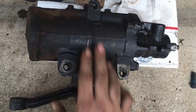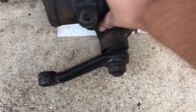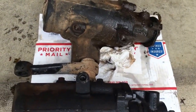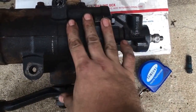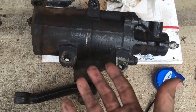Judging by that, I think this came off of a 4x2, and of course Broncos are 4x4. However, I'm going to leave this on for two reasons: one, I don't have a Pitman arm puller, and two, this is a much thicker Pitman arm — about an inch and a half at its thinnest, versus the Bronco's inch and a quarter. Also, the drop from the 2-bolt is a little bit longer, but that's made up for with extra casting reinforcements. There will be a slight difference in alignment, but I'm replacing all my tie rods anyway.